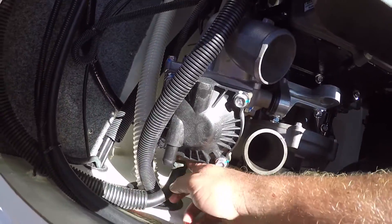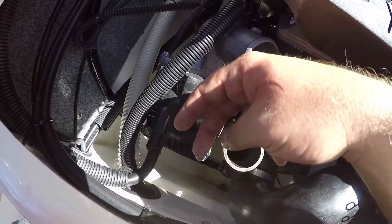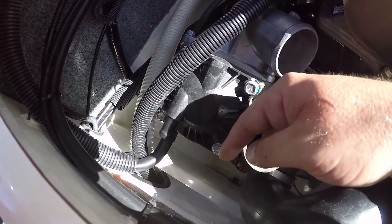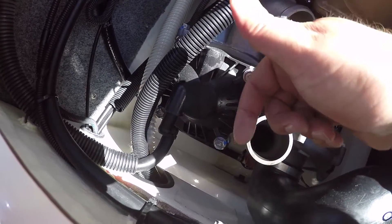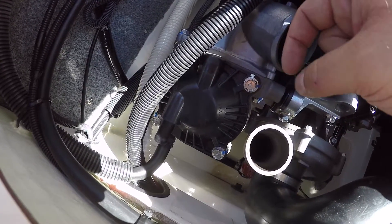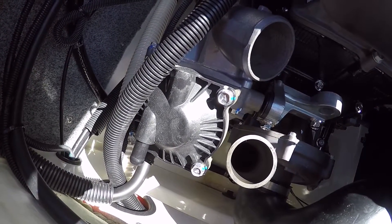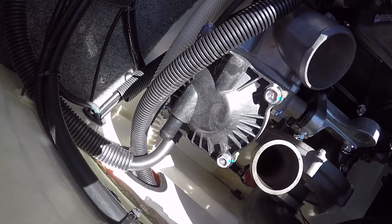Take your water line off where it goes to your pisser. The SVHO comes with two pisser outlets, so you'll need to either run a Y-fitting or run a dedicated line out to the side of the boat and add another pisser with a through-hole fitting and a deflector nozzle on the end. You can buy those — there are some links on the jet boat forum. I'm going to a Y-fitting temporarily; I've got a T-fitting right now but I'm not going to use that.